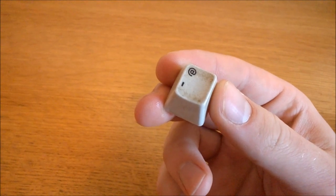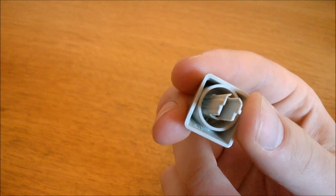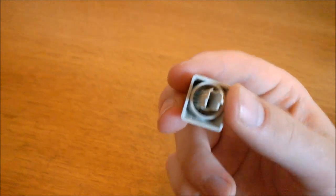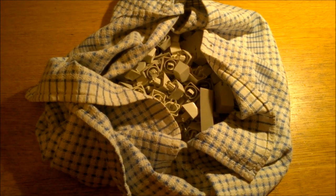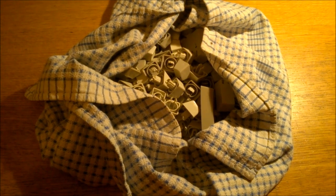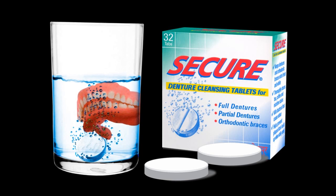When you're done, rinse the keycaps thoroughly. A lot of dirt won't come off from just rinsing, so it's best to hand dry them. Take a sacrificial towel and just rub them dry on all sides. Often water gets inside keycap stems and it takes ages to dry — you can get this out simply by flicking the keycaps using centrifugal force, which works a treat.